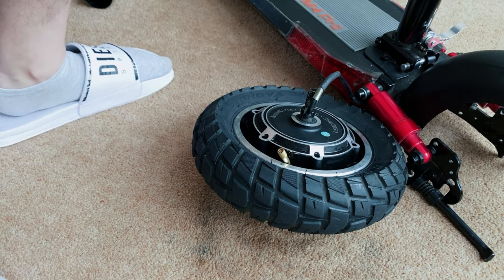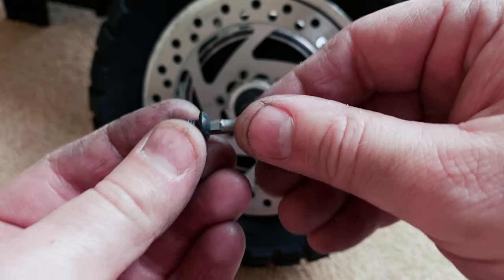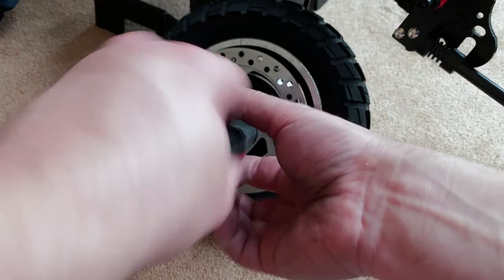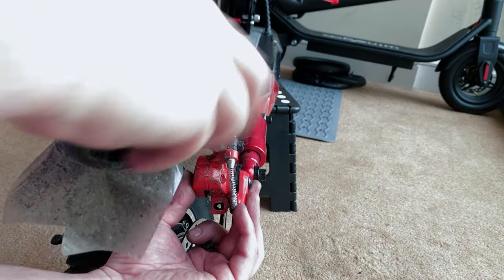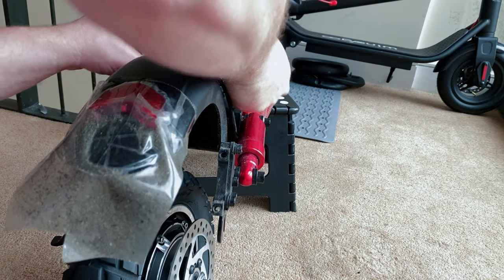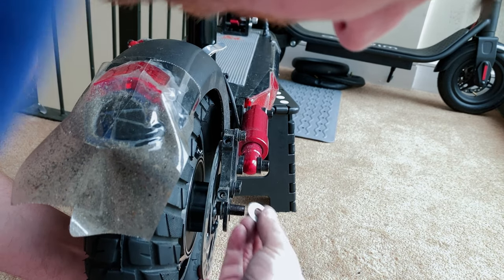You don't want to be rushing doing this. I've changed 3 or 4 tubes in this electric scooter and it gets easier every time. Take your time, have the proper tools, make sure you put the tire on the correct direction, and make sure you put the disc on the correct direction. Use correct tools and do not strip any screws. I actually removed the caliper here because it is a bit tricky on this electric scooter popping the tire and getting it sitting in properly with that caliper in place — I just took it out of the way and found it 10 times easier.